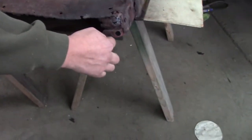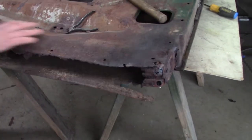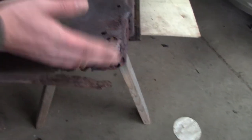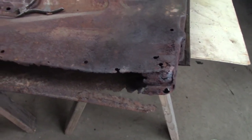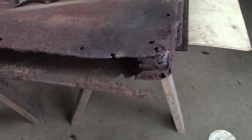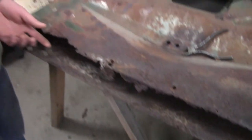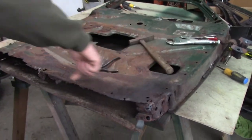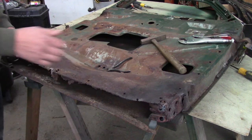So I'd leave enough material on the up-bend to go past this, but then I won't be able to shrink-stretch it. You might have to two-piece that — do a small L-bend and then put just a regular flat plate there. Yeah, so I can shrink and stretch into that. So it's going to be a lot of piecing and welding just to get the shapes right. You could do it in about three pieces, with a flat piece that follows the contour — stencil it or tack it together and then grind that corner. That'd be a good way to do it.